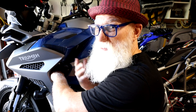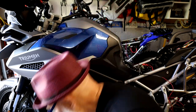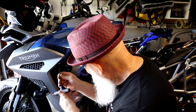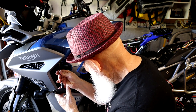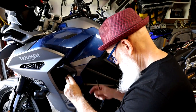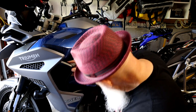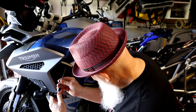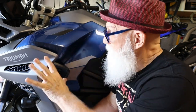They're all back in place, so now I'm going to cinch them down. Remember, you're going into plastic, so don't over-tighten. And of course I've still got the one back here. That's it — my wiring's run. Now I can finish hooking up the lights. So that's how to take this panel off and put it back on — not really too bad.